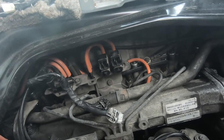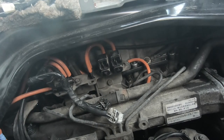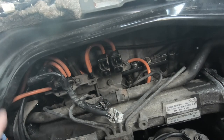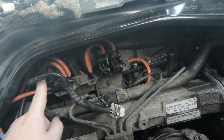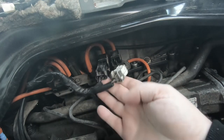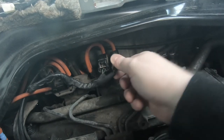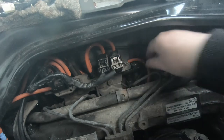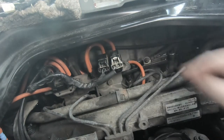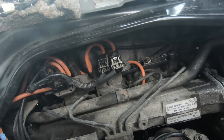Connect up your pipes before you forget where everything goes — take photos as you go, that's the best option. So we've come in from both the EGR and the inlet over here on the left, got all our pipes connected, and both electrical components for those valves are connected — they can only go one way, one shorter than the other, nearest to nearest — click and click. I just need to get this last one to fit onto the bottom one, and that's it — you're done.